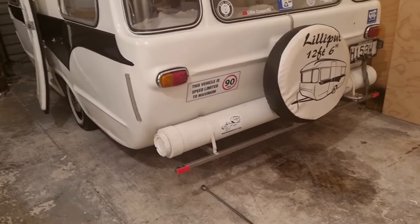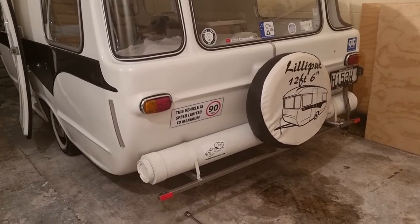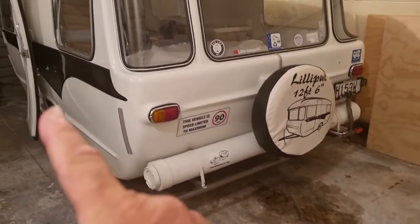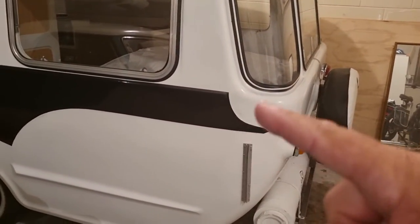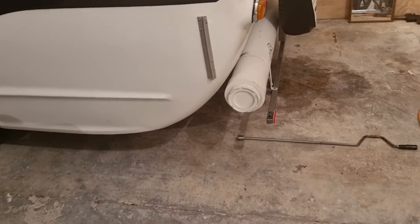One of the things I do before I work in the back part of the caravan is to put the stays down, but I also lower the front of the caravan — lower it so that the front is lower than the back because I'm working up in this area. So first thing to do: wind up the jacks.